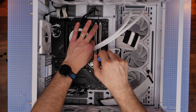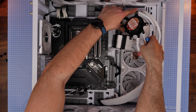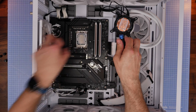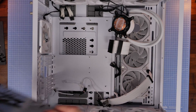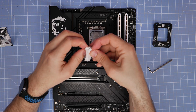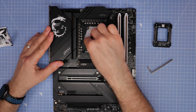You don't necessarily need to do this, but I want to show you why you potentially should in a second. What I'd recommend is actually taking your motherboard completely out of the system, unless you can easily access the back of the motherboard and the back plate around it. We also want to think about cleaning up the thermal paste and getting some new thermal paste while you're there, especially if you've been running it for a while, because that can help improve performance as well. I've got some Noctua wipes to clean up the CPU, because as you can see it's a little bit messy from the extraction process — some thermal paste from the cooler got on the CPU around the edges. So it's worth cleaning up both the CPU block and the CPU itself and just making sure that's nice and neat.